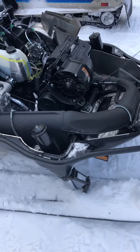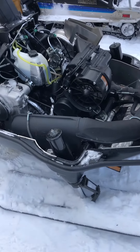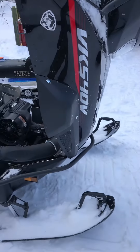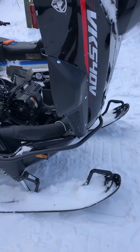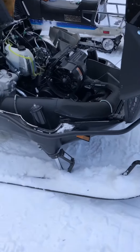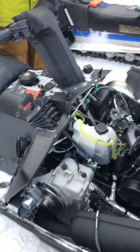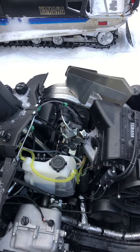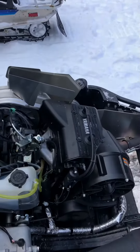2018 VK 540 — it's an excellent sled, but I've had issues with cold starting when it's around minus 25 Celsius, minus 11 Fahrenheit or below. So I installed a primer kit and it instantly cured the starting issues I used to have.